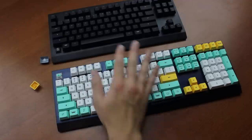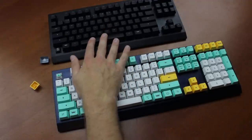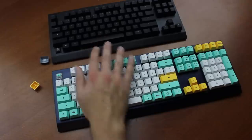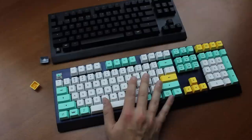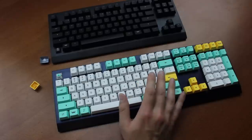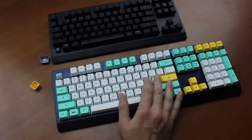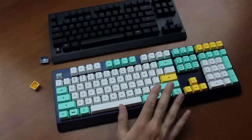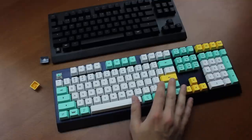The keycaps are better than the originals, or at least more durable. The original used cheap laser-ablated ABS keycaps in order to keep the product competitively priced, but this time they used Dyesub PBT keycaps instead. Although, as you can see, they look really weird with the backlighting kind of spooking through them. And personally, I think the colour scheme is pretty much... hideous! But that's just me. I think they do also sell black double-shot ones, thankfully.